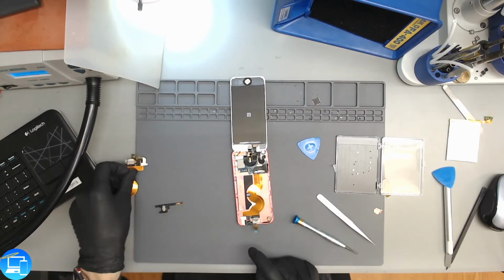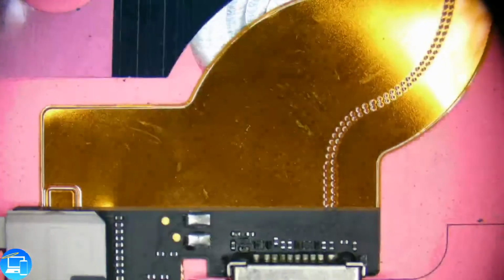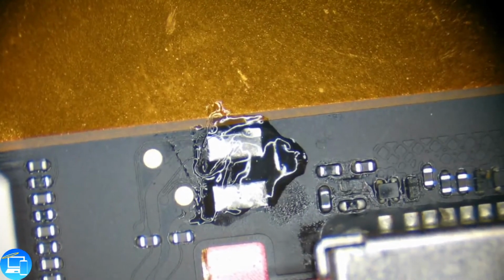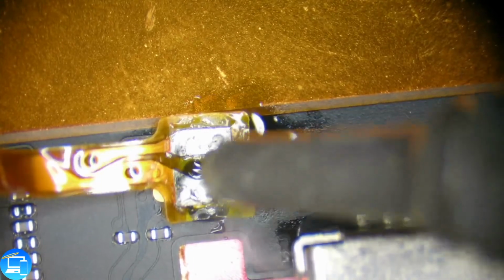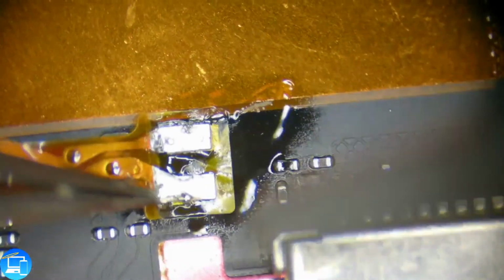Okay, we'll transfer this mesh off of this guy in a second. Let's go ahead and solder our charge port on. So like all solder points, we need to apply a little bit of flux. And this one I'm going to work really quick, so I won't turn on the fume extractor just for a quick second. Okay, so that one, it's touching, it's not pretty, so I'm going to take my tweezers and push down on the connection. There we go, much better.